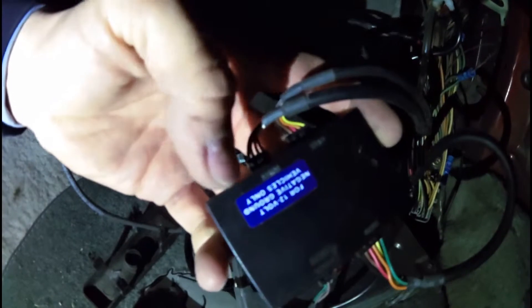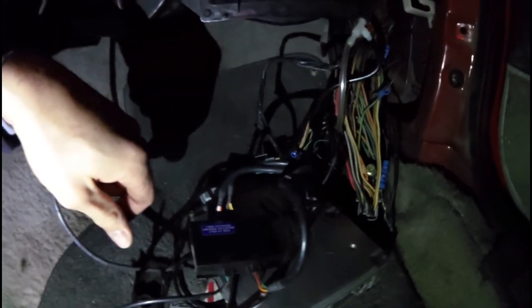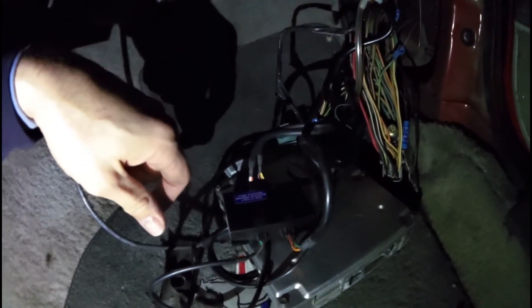Make sure you get the right connector. On mine — I don't know if you guys can see that — but this one here says 'sensor,' this one here says 'analog output,' this one here goes out to the sensor mounted in the exhaust, your O2 sensor. This one is your power, and this one goes to the gauge itself. My red was the power, the white was the switched power, and the black is your negative. Make sure you get a good ground on this too.